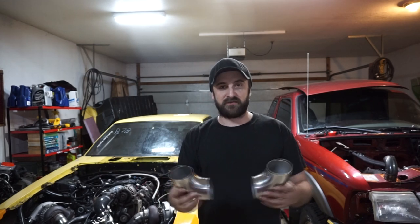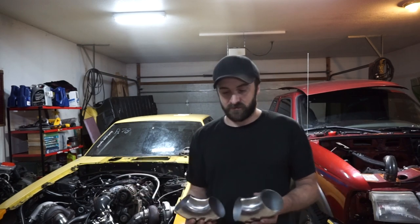That's why I'm going to put the little bullhorns on. My wastegate dumps are firing down straight at the ground right by the tire. The first day I went to the track I was leaving on like four pounds, so the wastegates were never opening while I was staging. But on the last day I was there, I'm staging and leaving on like eight to ten pounds, so the wastegates are opening and possibly firing right where the timing system is. I'm going to redo where my wastegate dumps are firing and do a little kick-up with some bullhorns to eliminate that. It's an easy fix, and if it eliminates it, perfect — because I don't want to run a 9.5 and have it show me an 11.5.